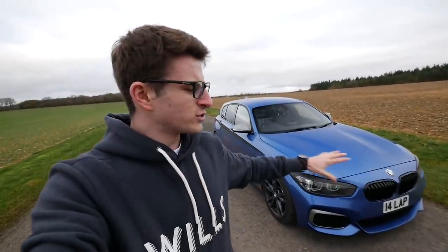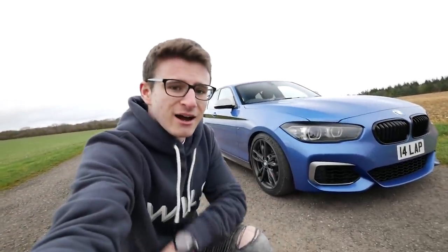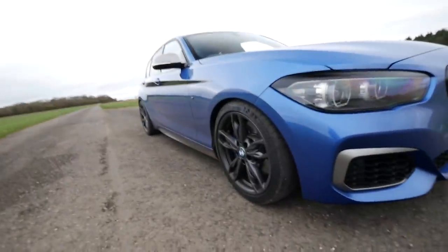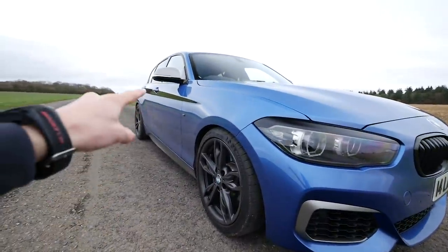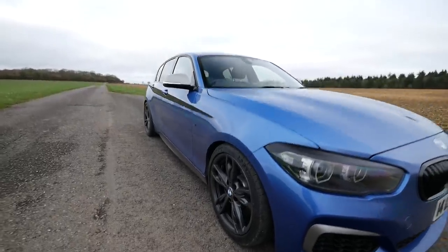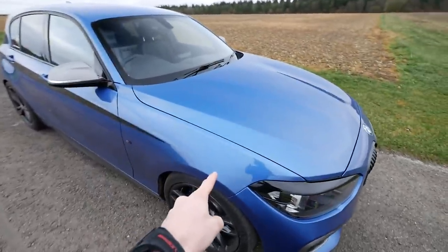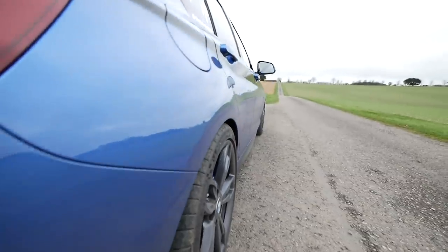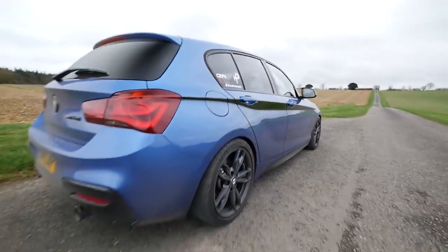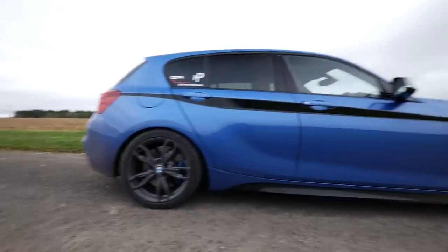I'm going to run through these mods in order, from the first to the most recent. The first was the Motec Stance Plus — still to this day I'm in awe of how good this looks. I went for the Stance Plus, which is a 30mm drop at the front with a 12mm spacer, and a 25mm drop at the back with a 15mm spacer. Those spacers won't be needed with the new wheels as they have a slightly wider offset, but I'll still be running the Motec Stance Plus springs. The fitment will look fairly similar and this car still sits so nicely — nice and squat.